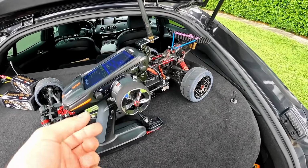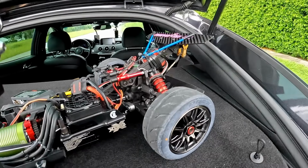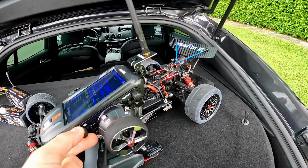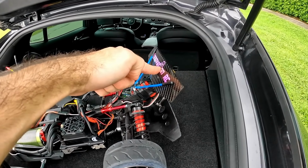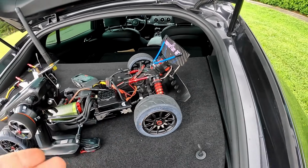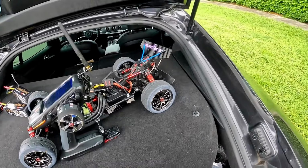Now obviously you can adjust it. If you want more speed, you can see it goes down. It's gonna allow air to pass. And then vice versa, we put this thing up. Air is gonna hit this wing and actually make the rear end squat because that's weight, that's really pushing down on the car, giving us traction to the rear.